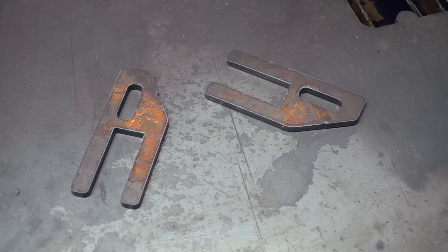The lower front half of the chassis has been tacked in and looks good. Now we need to figure out where we're placing our jack shaft, which is a very pivotal piece — pun intended — because it's not only the jack shaft but also where our swing arm is going to pivot. I used our Crossfire Pro CNC plasma table — you can get a hundred bucks off one at the link in the description — and I cut out some rear axle mounts inspired by the Honda Z50. Going to get those in place and tack some tubes onto them.